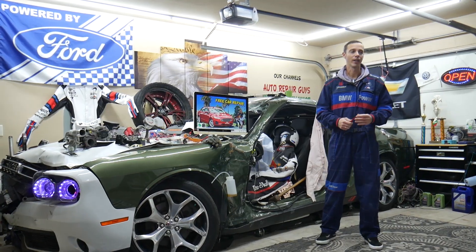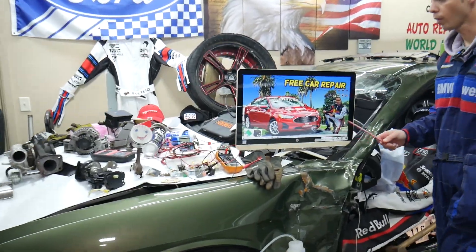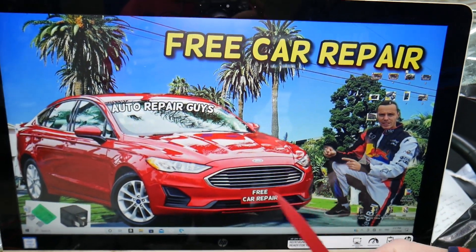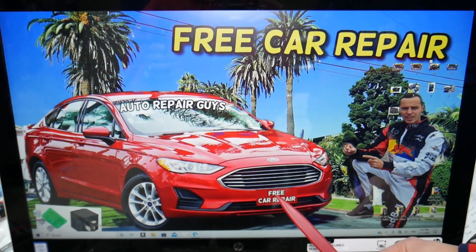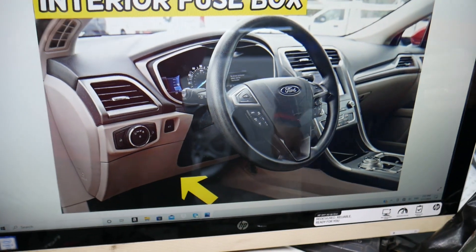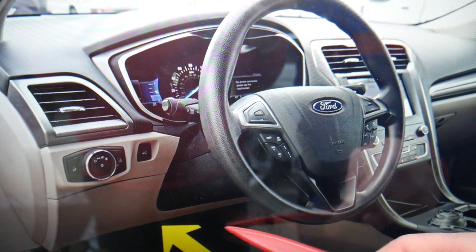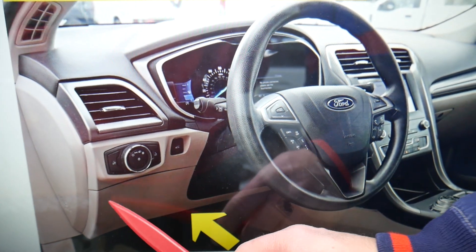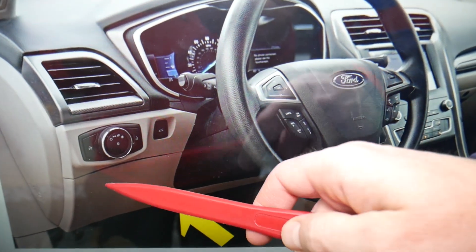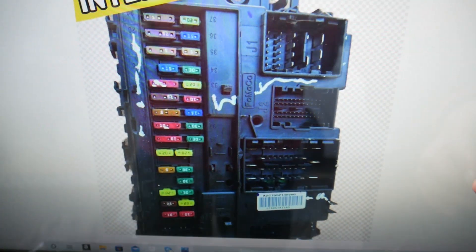Now, for the continuous control damping suspension fuse — we'll demonstrate on this Ford Fusion. We have multiple fuse boxes and some of them are extremely hidden. I recommend checking our video about fuse box locations on the Ford Fusion on our channel. We're going to come to the driver's side. You'll see that piece of trim under the dash that extends to the other side of the steering wheel — it attaches with four clips. Open from top to bottom and deep inside the dash on the left side you'll find the main interior fuse box.